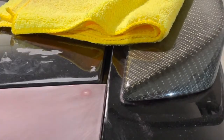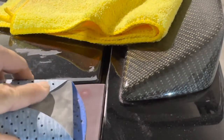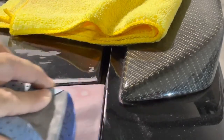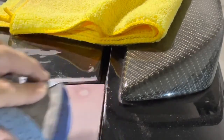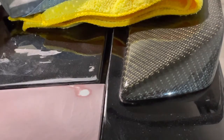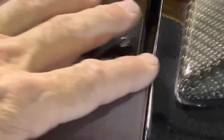This is a high spot — for some reason there's a spot in that panel that sits higher than the rest, and the paint is completely sanding away from that area, with primer starting to come through. Typically you can continue to sand those — it's a term called feather edging. You'll see the primer here, and then it seems like you've got a ring around it that feathers out into the surrounding color. If you can't feel it at all, you're good — the blocking got that right out of there.